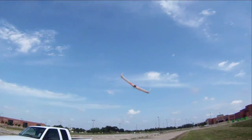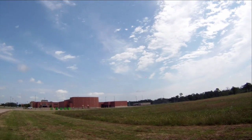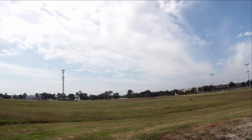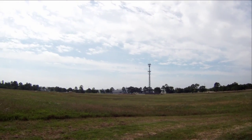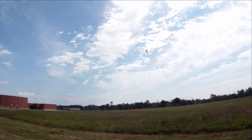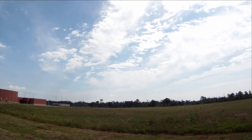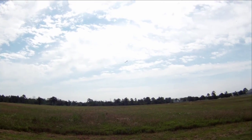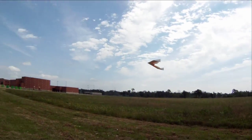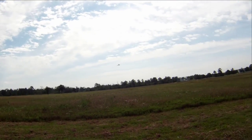Look for more flights on this when I figure out the power system issues. It's very slow. I originally thought the 1350 battery was too heavy for this plane, but now I'm thinking the prop may be on backwards, which is killing the efficiency. I'm going to check out the prop and see if I can turn it around. If that'll fix it, then I can fly with the 1350 battery and get in excess of 45 minutes of flight time.